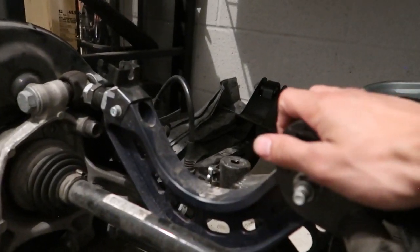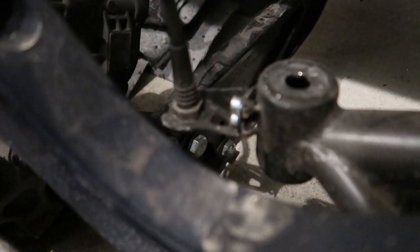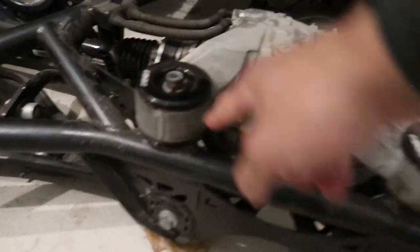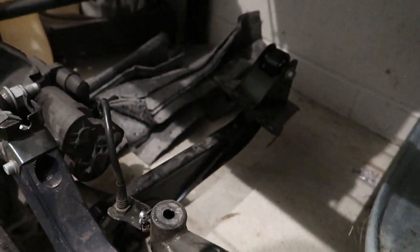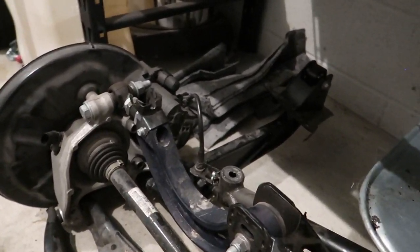I really wish I could just toss this whole rear end in right now. When I was posting on Instagram a lot of you guys said - I posted last night about getting a better zero to 60 - these trailing arms are adjustable. You can kind of see the adjustment points right there, there's two bolts. These are anti-lift, anti-squat arms. There are no real bushings in this whole rear end - the only bushings are the ones in the diff. Even in the knuckles I replaced those with metal bushings - there are metal bushings everywhere, everything's just metal. These adjustable arms in the back are really supposed to help with squat and lift during braking, like the rear end lifting. I think those will help a lot with zero to 60.